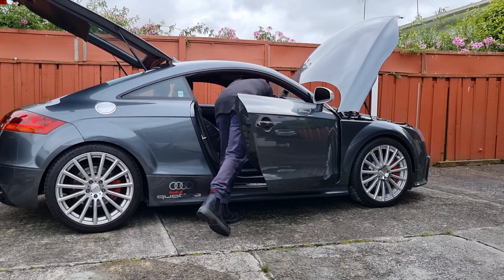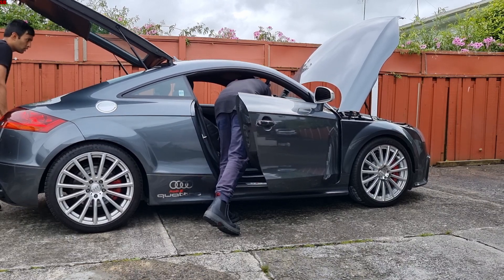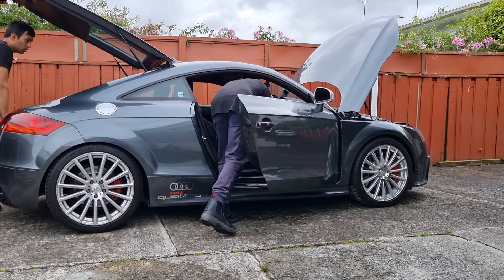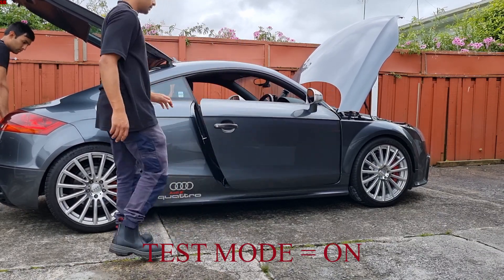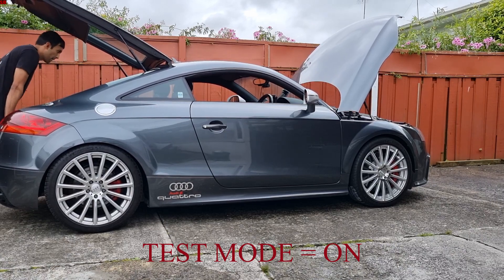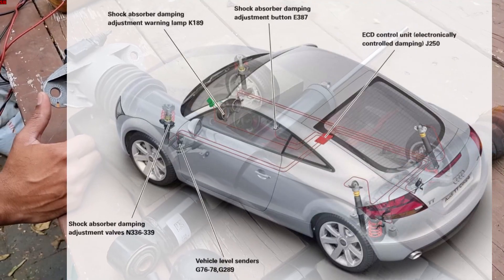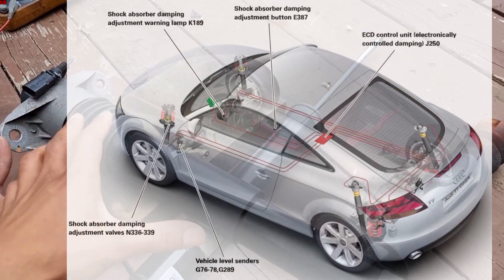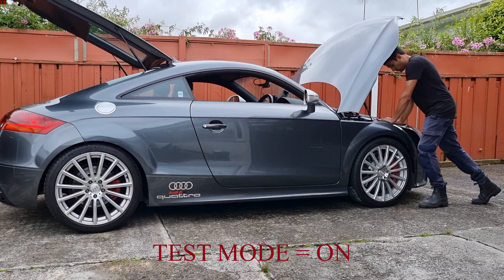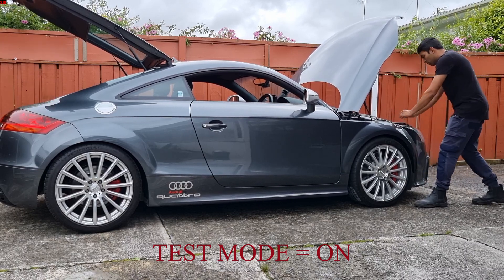Now I'll go inside and put it on test mode — watch the back being pushed down. I'll engage sports mode and you'll see it immediately stop bouncing. You saw that pretty much instantly. They push between about eight to ten amps per shock on each side through the control module. Going to the front while that's still engaged, notice the front has also become quite stiff.